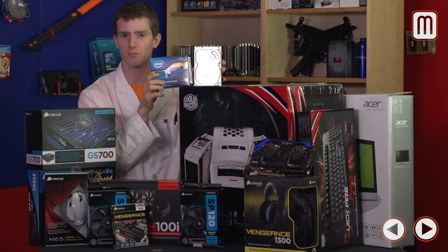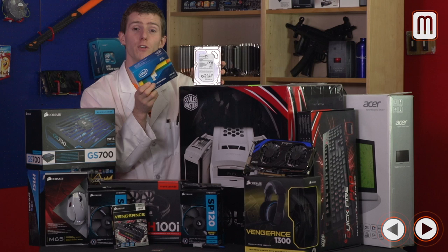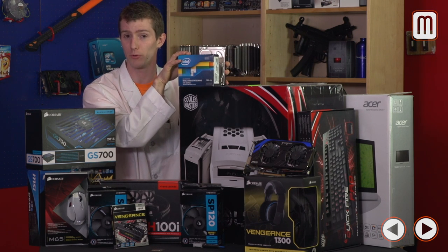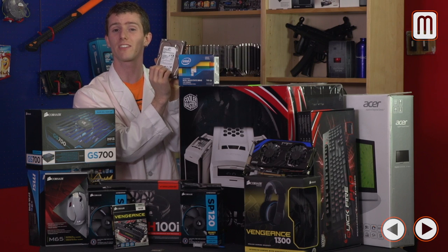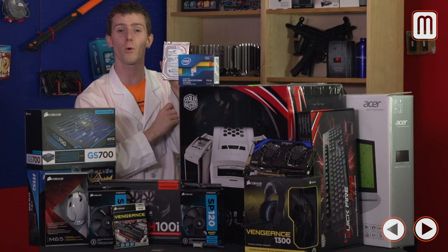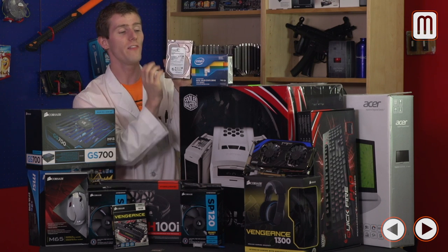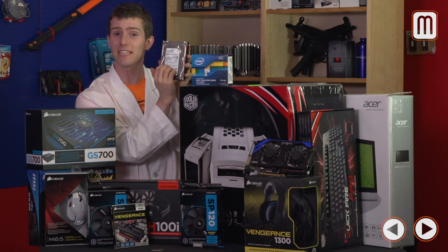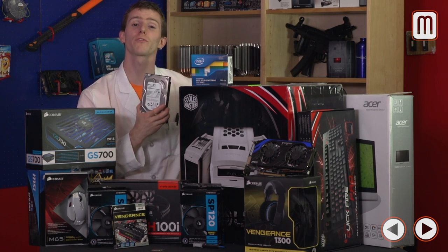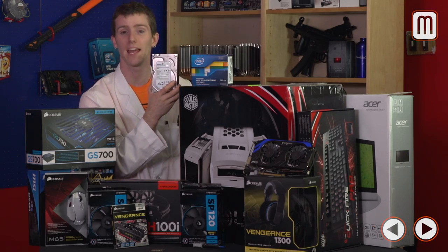This gives us a couple of interesting options. You can go with the 180GB drive and 3TB for storage, or if you find 120GB is enough, you can use a 120GB boot drive, partition away 60GB of it, and use it as a cache via Intel Smart Response Technology built into your Z77 board. That gives you a speedy boot drive plus SSD-accelerated mass storage for games and frequently used applications.